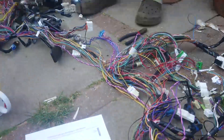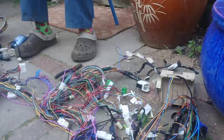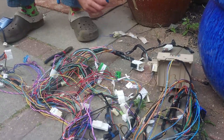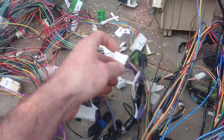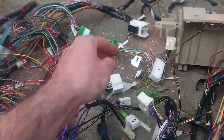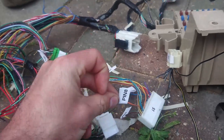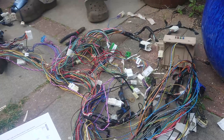So we're on a quick tea break. We've so far got rid of the clock circuit — we started on that because it looked like the easiest page and we knew for sure we didn't need it. We've moved on to the clearance light and illumination system, basically dash illumination, because we know we're not going to need that. We started from one connector. We've got a label maker and we've labeled all the connectors that we're working on, and we're labeling wires as we cut them — so that wire goes to I-59 connector pin 8. So everything is labeled so if we need to know where stuff has come from, we know.